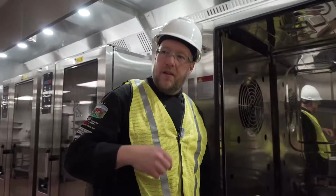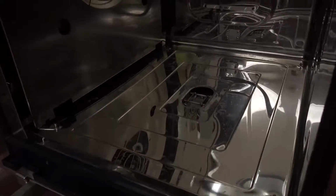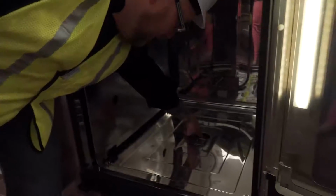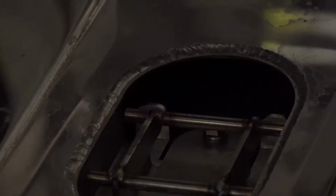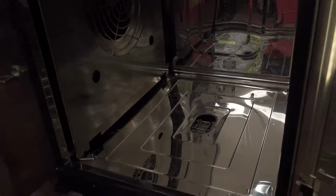If you guys can look over here, if you need to walk over or not. This is critical. I've seen people botch this a couple times. The screen comes off the drain. The tabs go right down in here. The tabs look like little white suckers, almost like a dishwasher tab. They're just little pucks, tiny little pucks. They slide in there, in the back, and the screen goes back on.